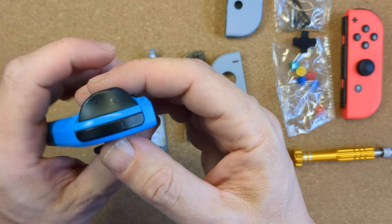Now onto the other Joy-Con. Again remove the four tri-wing screws, use the separating tool to pop the shell apart and separate the two halves of the controller. This one has the infrared camera and the amiibo scanner, which means a few more parts and wires inside. There's a small antenna board to move out of the way before using the spudger to pop the battery out — take your time because you don't want to damage, bend or twist the battery. Once it's out, unclip the battery cable. The screws are in a different place because the stick is lower down — there are two gold screws at the top and one at the bottom. Move the wire and the little board out of the way and lift up the mid frame, but be careful: the ribbon from the trigger is much shorter on this one and very fiddly to get at.